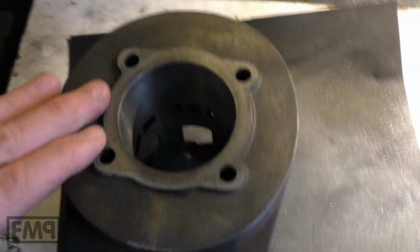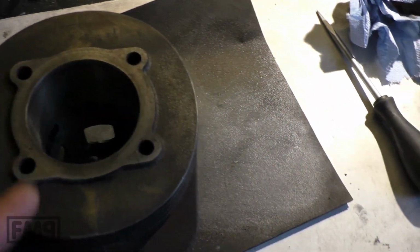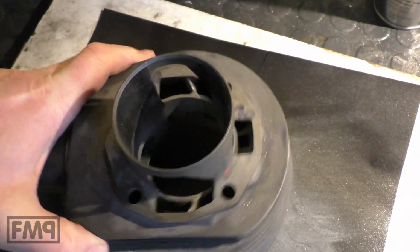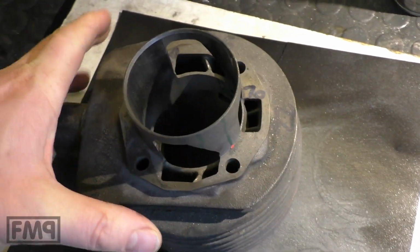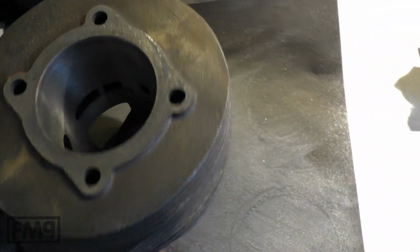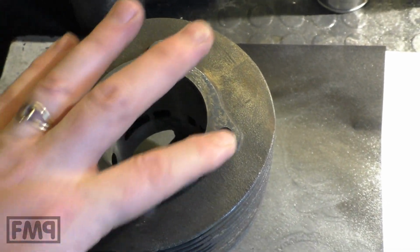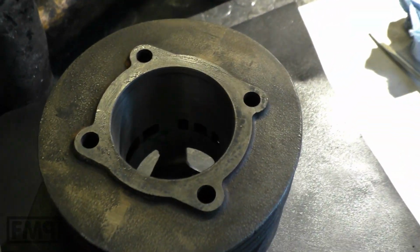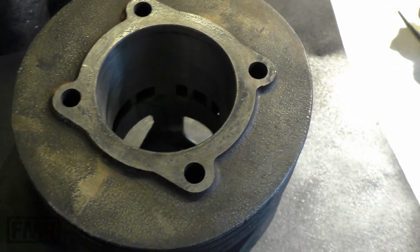Another thing you could also do, should do, is the top of the cylinder where the cylinder head sits. Also sandpaper it with the same method. Put it down, push it down, twist it, turn it, pull it, push it. It's also kind of a cleaning. You will get even marks here. This will also ensure that it is gonna be tight with the sandpapered cylinder head.